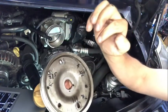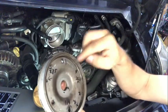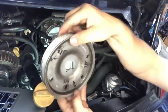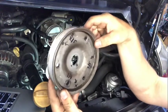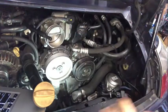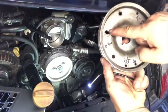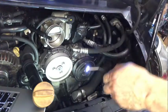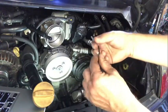I also made some marks on this pulley. This will be the actual position we have to line up when we scope the upper part of the cylinder wall — slightly ahead, about 30 degrees ahead. That makes it much easier when inserting the camera. Let's proceed with the first cylinder. We brought the crankshaft into this OT position and a little bit back.